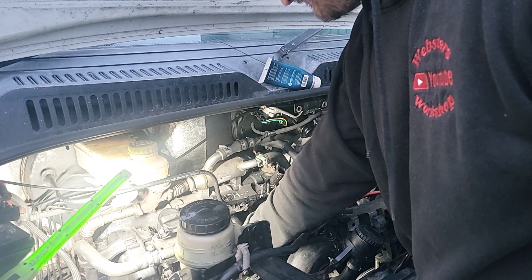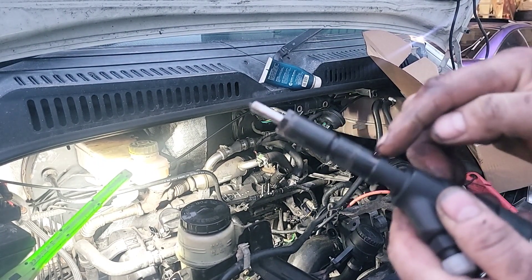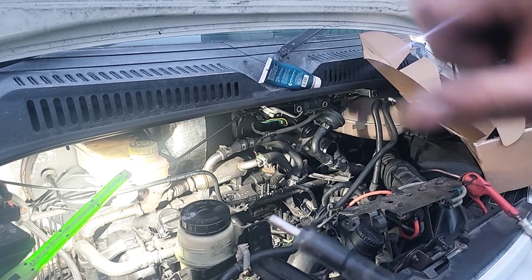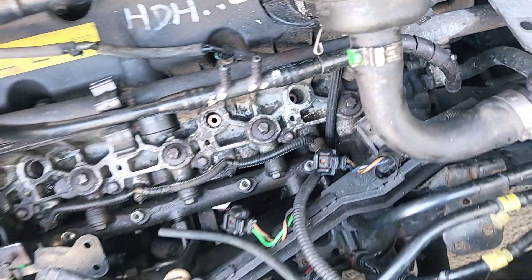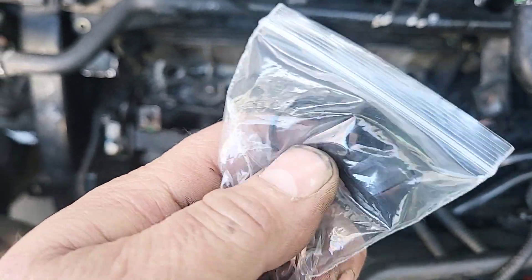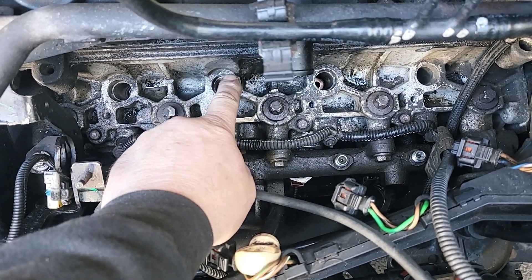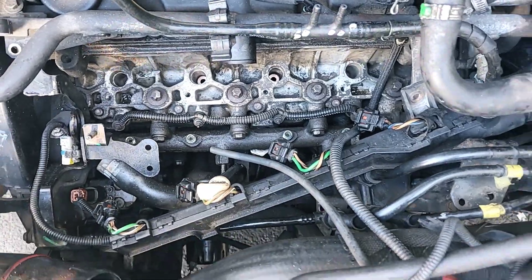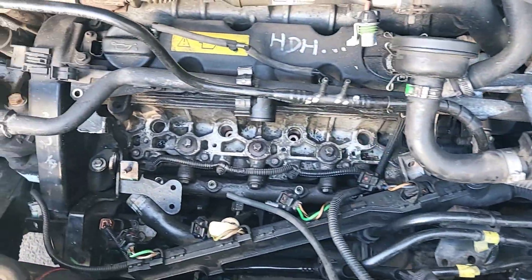Excuse the compressor. We can't use these yet because there's a plastic seal that sits on the top, so I'll have to try and source those. We're back — we've cleaned the holes and dropped the injector seals in. These little black rings sit in a groove at the top of the injectors: one purpose is to locate the injectors and stop them wiggling, and two is to in theory stop water running down into the injector holes. So we'll just start building the injectors in and get them stuck in.